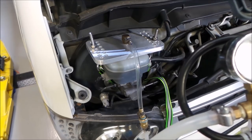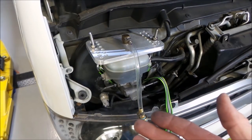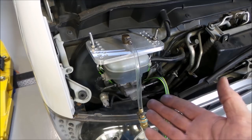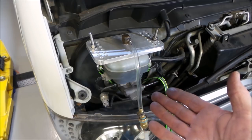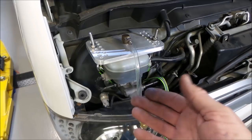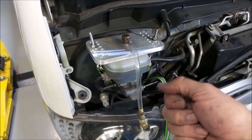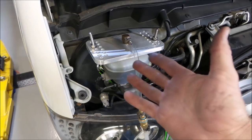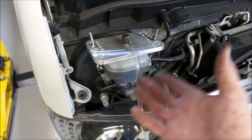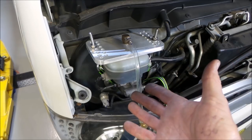So what we do now that the brake master cylinder is pressurized, we can then go to any corner of the vehicle, release the bleed nipple, and fluid will be forced through by the pressure in there until it gets to a point where there's not enough pressure. So basically, you just monitor the fluid that you're pulling out and the pressure that's driving it out. If the fluid stops coming out before you think you've anywhere near used all the fluid in here, you just nip the bleeding nipple back up, come around, either repressurize or refill, and move into the next area. You'll be surprised how quickly this will force brake fluid through your motor vehicle's braking system and give you nice clean fluid with minimal fuss.